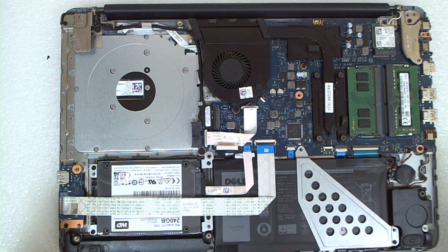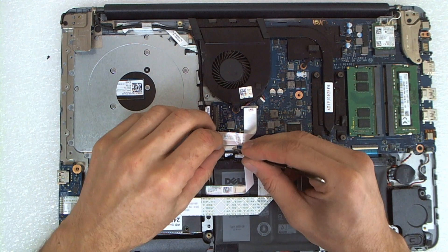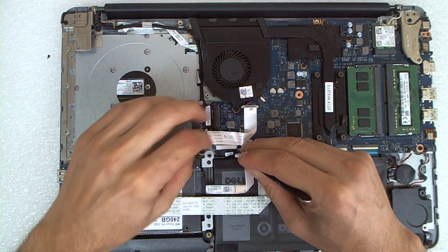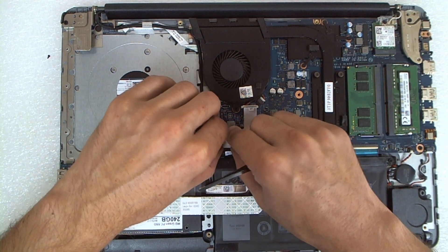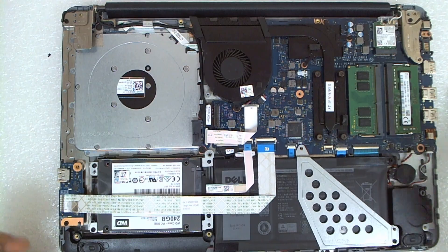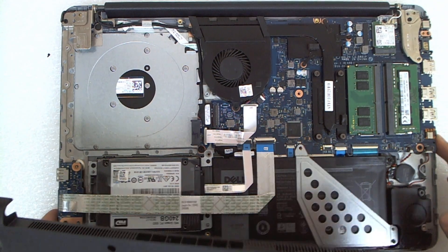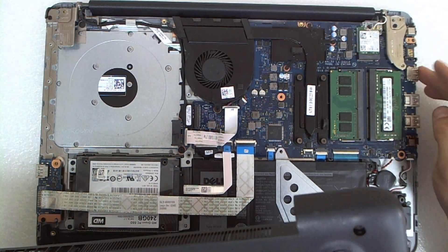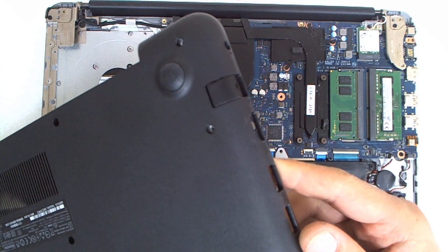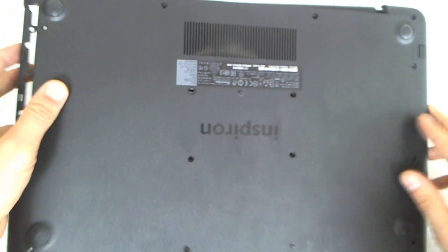When you're sure everything is connected, we only have to plug the battery and we're gonna assemble the laptop like this. Now we're gonna put back the cover. In this case we have a lot of USB ports and HDMI here, so it's much easier to put this side first because you won't apply pressure on the ports — just make sure you plug them correctly.